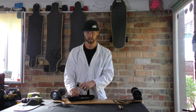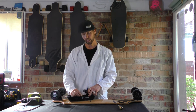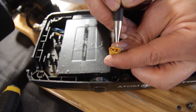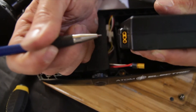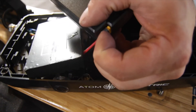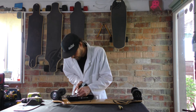When you are making the connection, you'll see that it's a three-pin connector. It's got a way that it goes — there's a little piece in the plastic that will prevent you from making the connection the wrong way. You'll see a little protrusion on one piece and a dent in the other that will make sure you connect it the right way. When the battery is out, go ahead and push that in there, really get it in there. You just want to push it until it actually stops — most of the way to where you're not seeing a whole lot of yellow, and you'll feel it kind of hit the bottom.